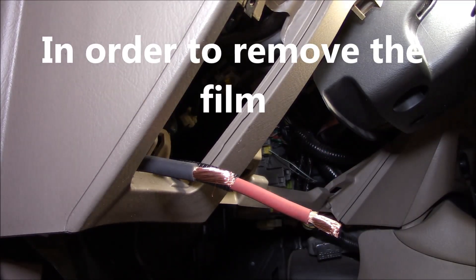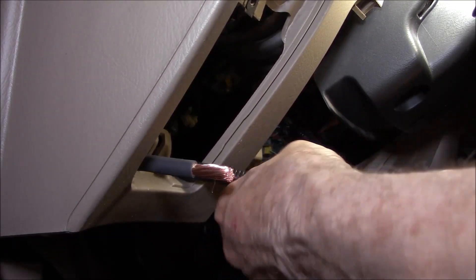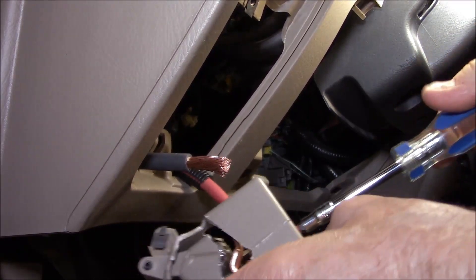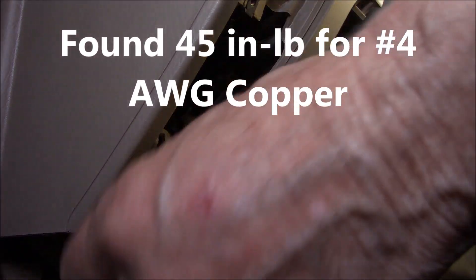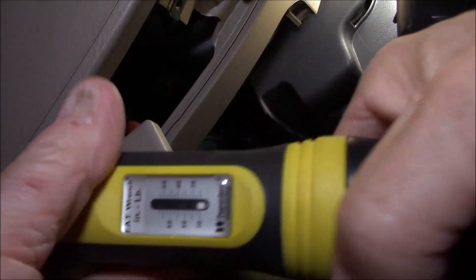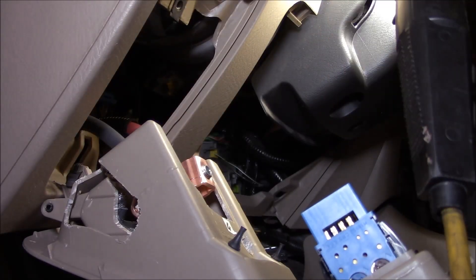You need to remove the film on the wires with a stainless steel brush, because there is a coating on these wires, and they say that you should brush that so it makes a better connection. I'll have to torque this to the manufacturer's specification. I just have the Wheeler FAT wrench, which you simply pull out and turn, and then the dial will show you when you've reached whatever torque you want. I will torque these and then show them with the cover on once that's finished.